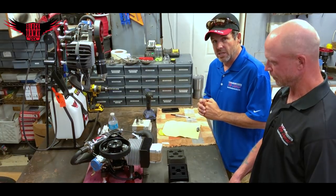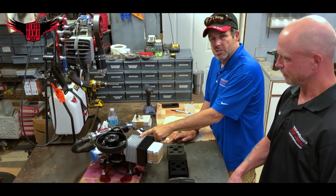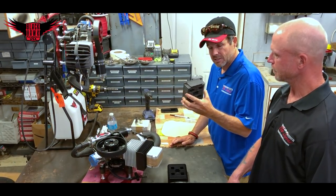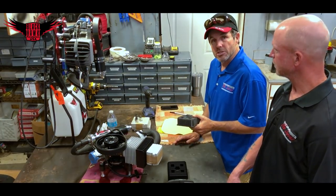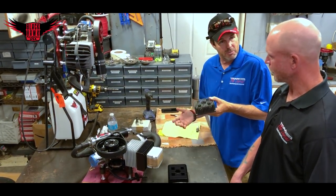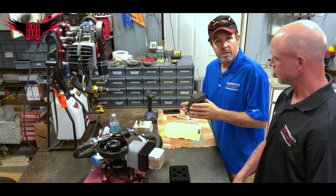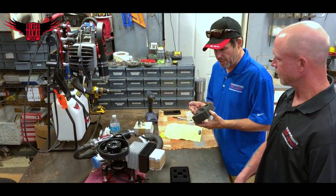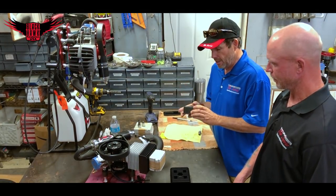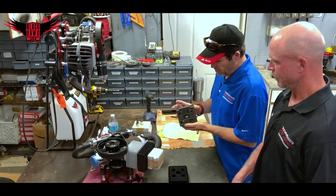What I'm going to show you today is why Black Hawk does things the way we do. Here's the 125. Every manufacturer is purchasing cylinders, pistons, gaskets, and a cylinder head as a kit — they're all cast and built as such. The reason is a lot of these motors come from scooters, and scooters don't run 9,000 RPM all day. Especially with the advent of smaller gliders, for straight and level flight we're typically looking at 5,800 to 6,400 RPM — that's a fair amount for a two-stroke engine. In order to dissipate the heat, it takes the cylinder head — that is what the cooling fins are for, on both the cylinder head as well as the cylinder itself.